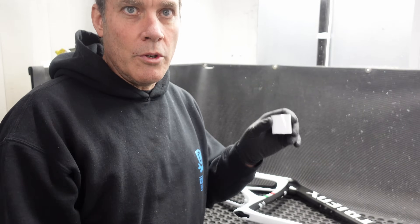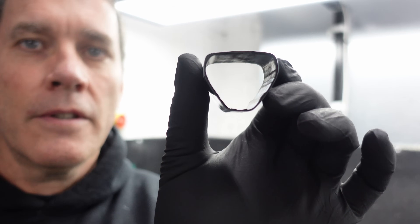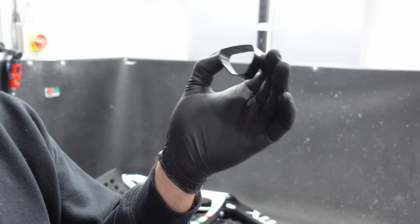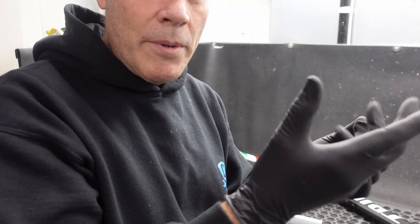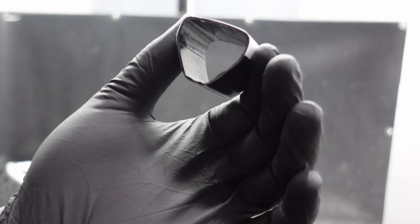Looking at the cross-section, the white part is the top of the tube. For performance bikes, there's no reason why the top of the top tube needs to be fat — they put less material on the top than on the bottom. The disadvantage is it makes the top tube a little more vulnerable to clamping. But it's a performance bike — this is what you can expect. One good thing: the wall thickness is pretty good.